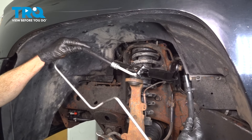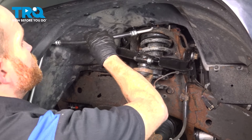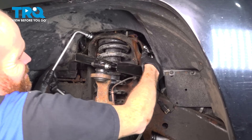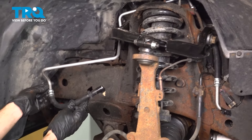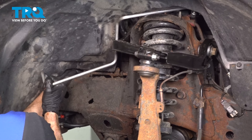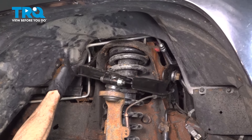Let's get ready for the installation of our brand new power steering return line. You'll notice on the new line that I've taped off both ends — that's to protect it from any debris making its way into the power steering system. Take this and start bringing it up and over to reach inside. We'll take the forward end and try to slide it up and inside, then gently press everything in where it needs to go, using a little bit of gentle persuasion.